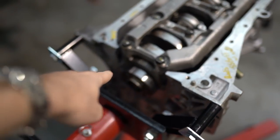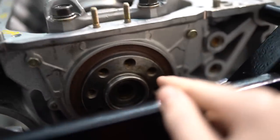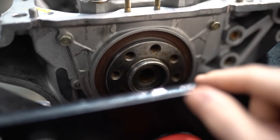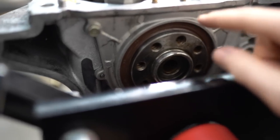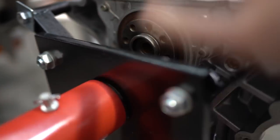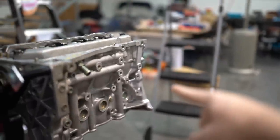To begin with I'm just going to do the rear main seal, and then we'll move over to oil pump and timing and lots of fun stuff. There's the rear main seal and cover in. All you do is put some grease on the inside of the seal so it slips right on, and some silicone along the outside of the cover, then tighten it all up. I also use some Loctite on these because that's definitely something you don't want loosening, especially with the clutch in front of that. Now we shall move on to the front side of the engine.